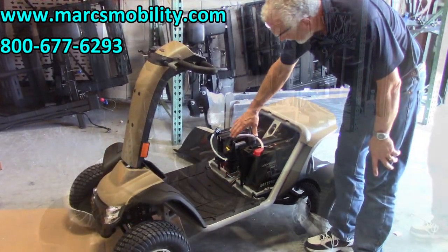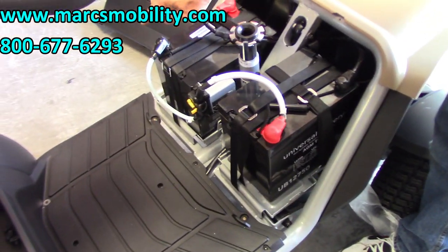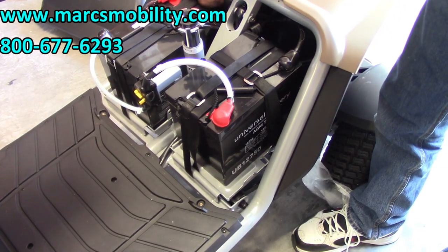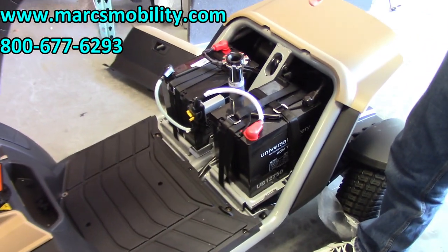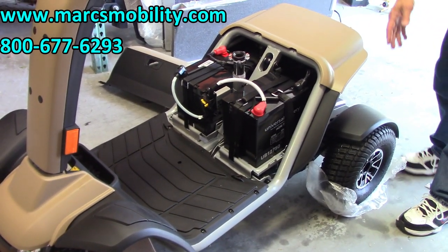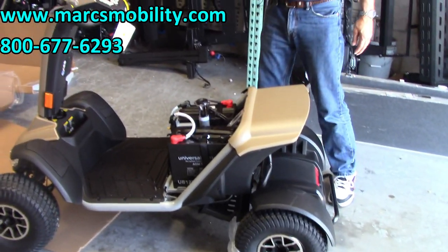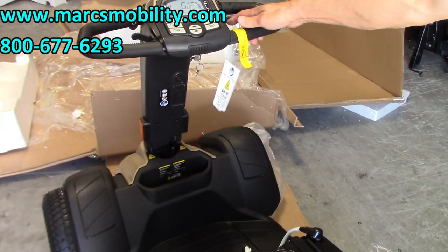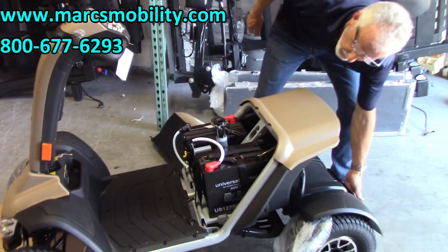On the front, the white cable with red goes to the red terminal; the other white cable in the front goes to the black terminal because it has a black boot on it. On this side, a red cable from underneath goes to the red, and the black goes to the black — they're all connected. Make sure you put your scooter back in gear once you have it out. If it's beeping, it's because it's still in neutral. Turn the key on, give it a few seconds, and you can see the display — the scooter is ready to move.